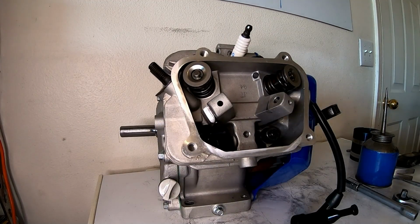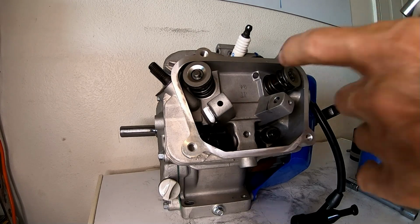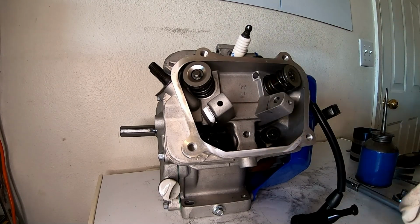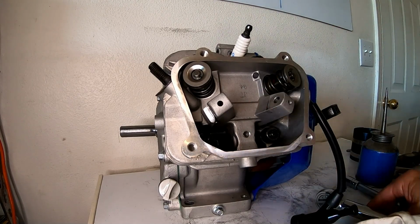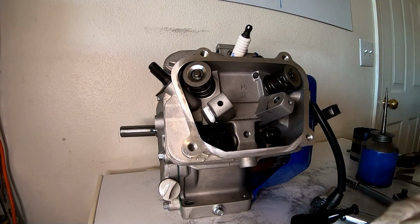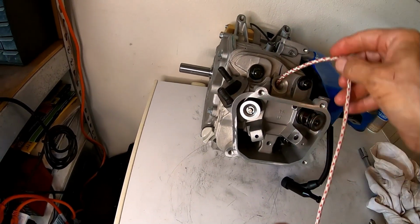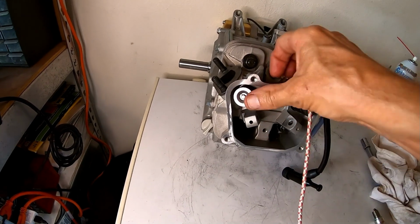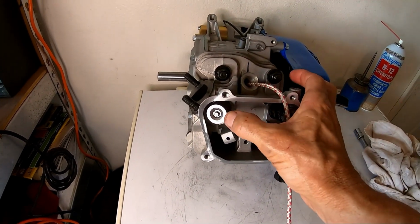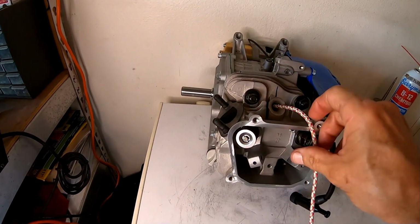Now let's go ahead and pop those valve springs on there, these 18 pound valve springs, and we should be good to go. Then just set the valve lash. I don't think the pushrod geometry is going to be off really that much because of the thinner head gasket. I mean, it's not that much. And fill the combustion chamber with string. That's when I fill her up. Then I can push the retainers down so the valves don't fall back down into the head.